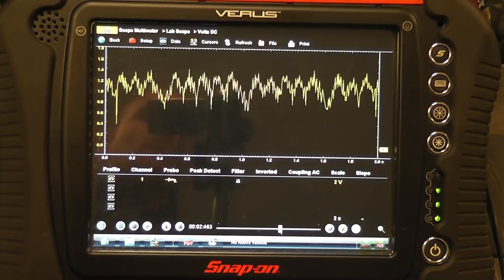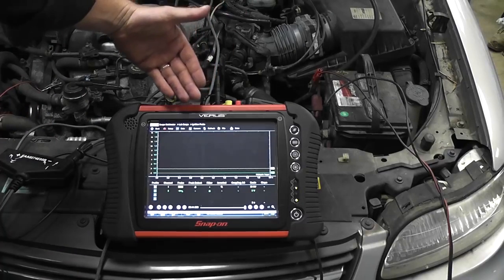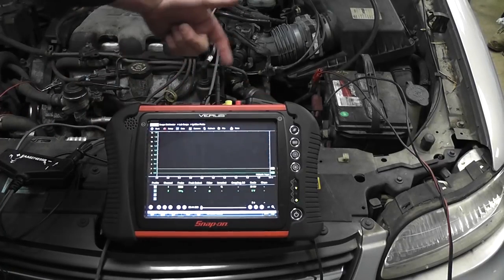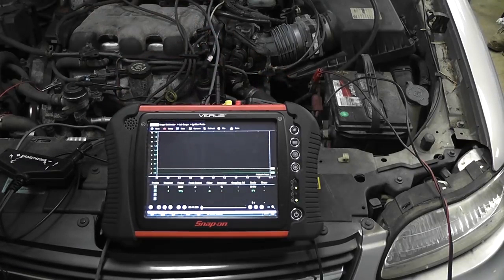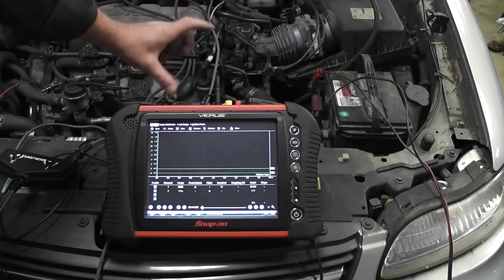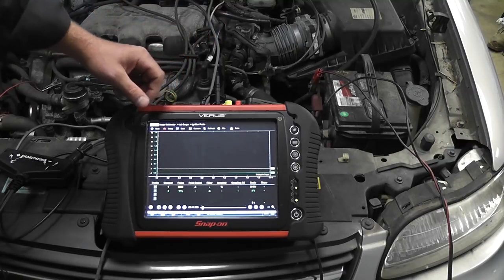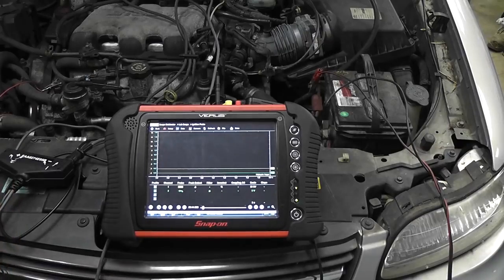There's another method that's a little bit more complex. What's going to happen is we're going to have amperage readings from the starter on the second channel — the green trace. And the yellow trace is going to be my ignition firing of the number one spark plug wire. This is a waste spark system, so on compression you're going to have a high firing KV, and on exhaust you're going to have a low firing KV. That's important in cylinder identification once we plug in the numbers.